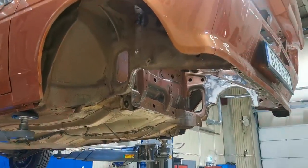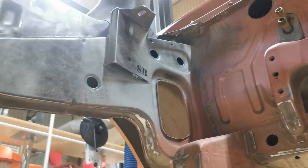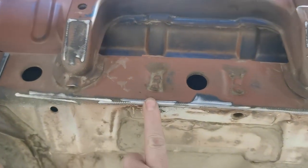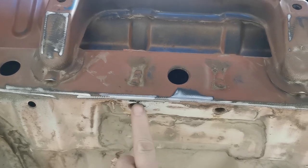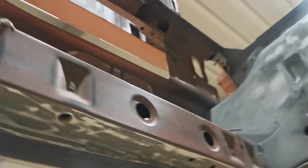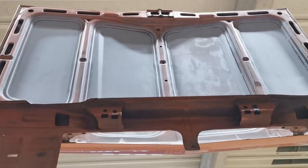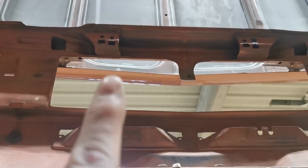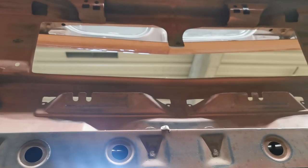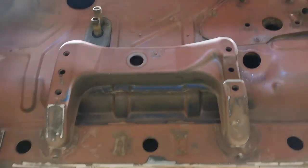Alice is all the way up there ready. As you can see, she's pretty much ready for paint now — the underside is clean and ready to go. I'll be painting to roughly where the bracket goes for the engine cradle. Underneath the wheel arches won't be done at this moment; they'll be done later with proper body coating. But the engine bay, underneath the engine bay, and the bonnet up there has been primed ready. So all I need to do now is mask off the gaps where paint will come out, mask off the rest of the car — wheel arches, wings, bonnet, roof — and then we're ready for paint.